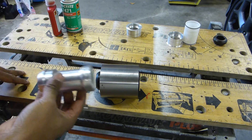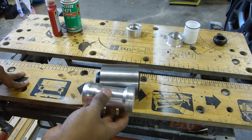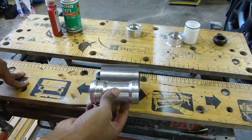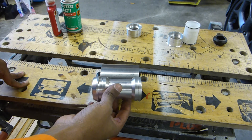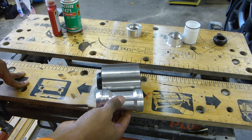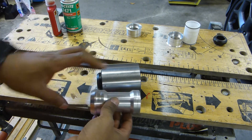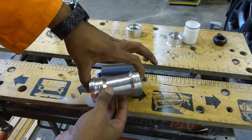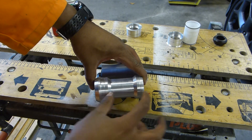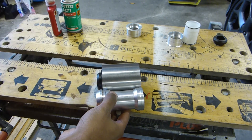The other option is to actually change the bottom bracket. This is one I made. For Cervelo, I would always advocate the use of a one-piece bottom bracket — it's much more effective than a two-piece or three-piece. This just slides in from one direction; it keeps the spacing at 90mm, 79mm across the landings, and then you're away.